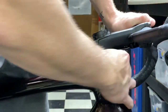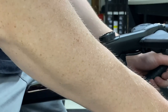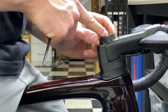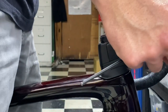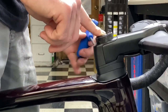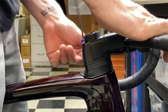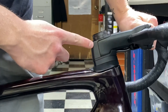Get everything lined up — make sure it goes straight. If your spacers aren't lined up with the frame's aero cutout, loosen the top bolt just a little bit to maneuver it into position. This bolt just needs to be snug — it's only compressing. The pinch bolts on the side you want to tighten up to 5 Newton-meters, as those are what actually hold everything together.